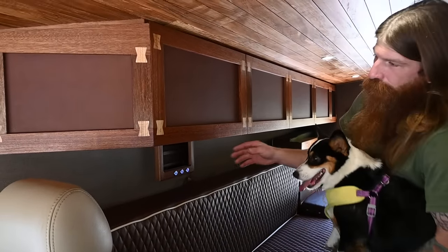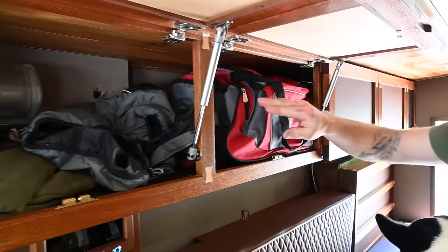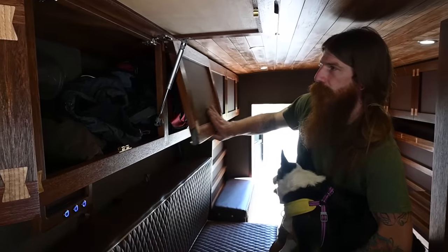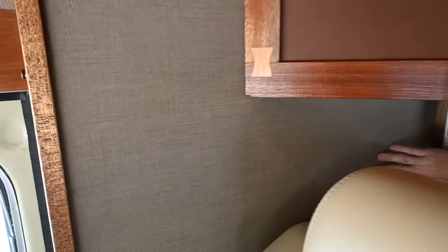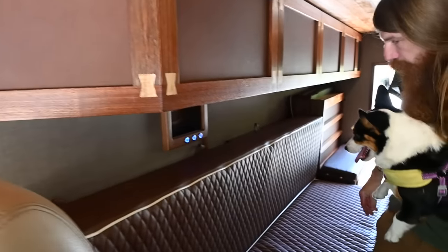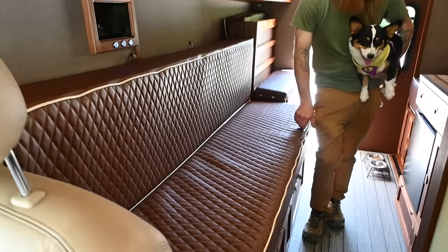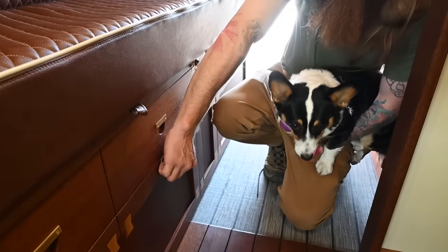Going back with all of these cabinets, I did the same thing and milled all the rough-cut material. The doors are all mahogany and maple, and I did quarter-sawn inlay bow ties throughout everything, along with brass ball catches and power struts. All of the wall panels are ½-inch plywood covered with Sunbrella Marine Outdoor Upholstery for durability. I have a couch that folds down into a bed — I did all the upholstering here in marine vinyl with diamond stitching. Down below this whole couch area is all the electrical for the van.